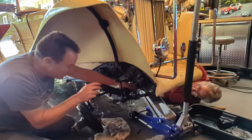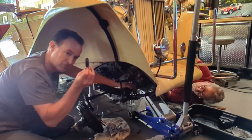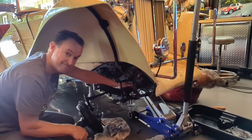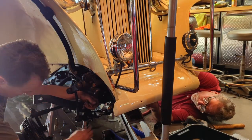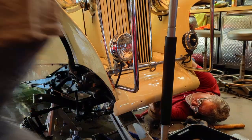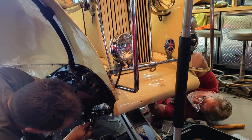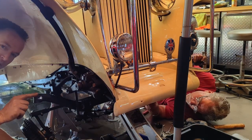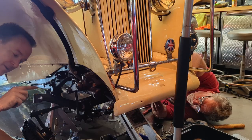Both sides are back on, so all we need to do is reverse the process. As the Haynes manual says, reassembly is the opposite of disassembly. Don't forget your little plates on the bottom — get those on there, double nut the bolts, get everything torqued properly. When you put these knuckles back on the axle, make sure the thrust washer is fixed on the bottom side — you need a thrust washer right there. And if there were any shims on the top when you took it apart, make sure those go back in the same place.